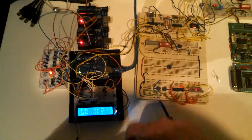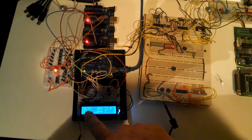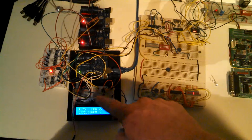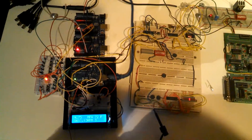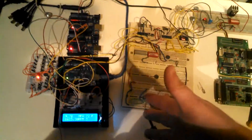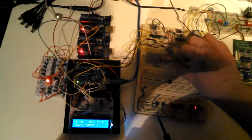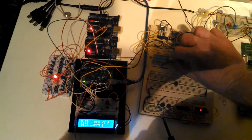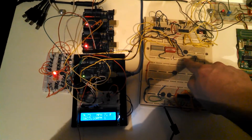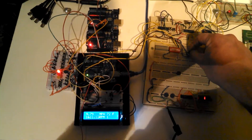So there's first gear. In the code — which I'll post — I'm under ten miles an hour, so when I brake under ten miles an hour it'll drop to first gear. From above ten miles an hour, whatever gear I'm in, it'll drop to second gear. Let me go ahead and trip this second switch — there's first gear. And since I'm below the threshold it stays in first.